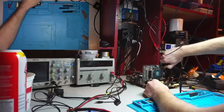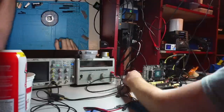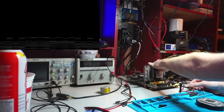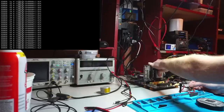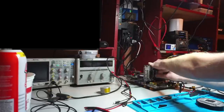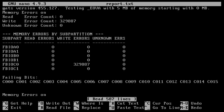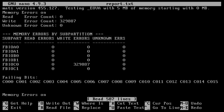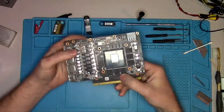Okay, let's plug this card into the motherboard and see if we get a picture. It looks like we have a picture, but I can't get my test to work, so I'll have to switch to a T server, which really sucks because I have to put the heatsink on in order to run it. And when I did, I got an error saying that bank C0 has errors. Okay, so let's figure out which one of the memory chips is C0.